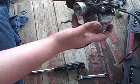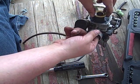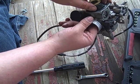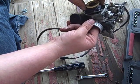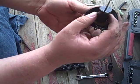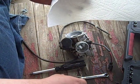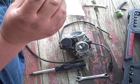And your diaphragm. I'm just going to push him up from inside the carb here and gently break this loose. You don't want to tear this either. Then you're going to have a bad day, because you will be ordering one of these at who knows what cost. Take that out. Just make sure that's clean. Your best friend is going to be some paper towels. Just wipe this guy down. He looks in really good shape.